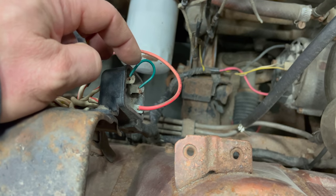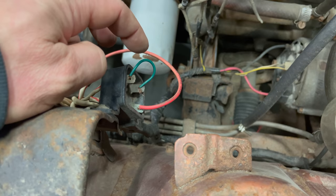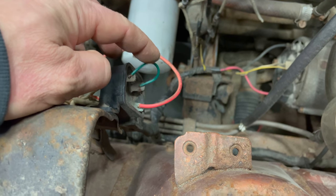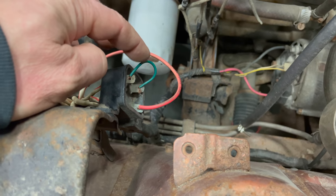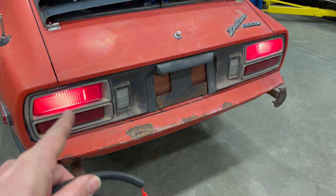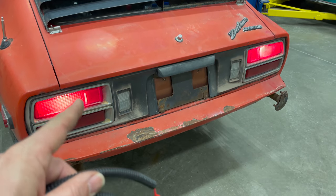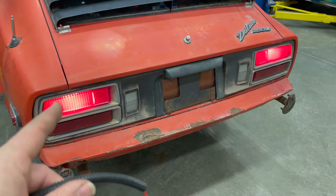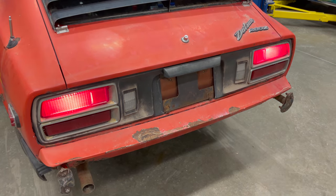I do think I have some fusible links sitting around, but for right now I'm going to get my jumper lead that has a circuit breaker installed on it and put it here instead. That way it's a much safer option and I'm not burning up fusible links. I was walking around the car and noticed that the brake lights are on, so I need to deal with this first before we move on to the fusible links, because if I leave these on it's going to drain the battery.